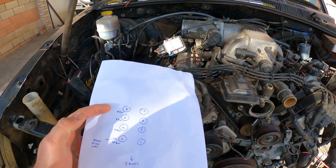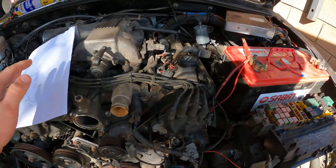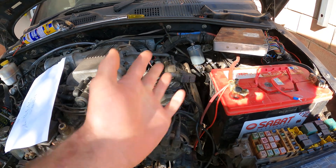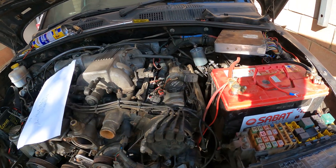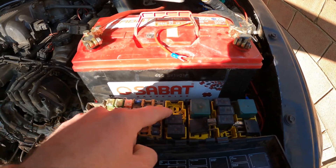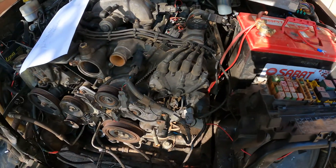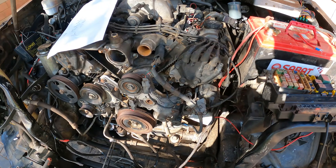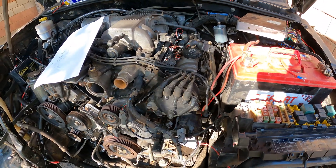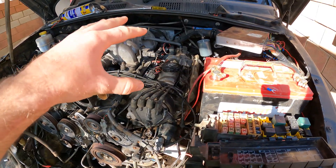My readings so far are quite good — I've got 10 bar, 9 bar, 9 bar, and 11 bar. The spark test on all of them are fine. So what I'm going to do now is take out all these spark plugs and do the compression test on all of them as well. As I'm doing the compression test, I'm just bridging out my starter motor relay — that's easier than hopping back into the jeep every time I need to turn over the engine.